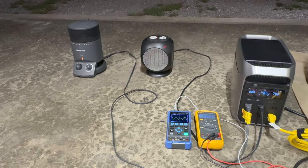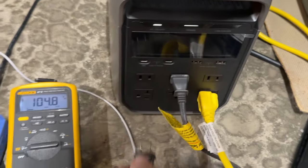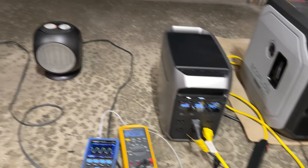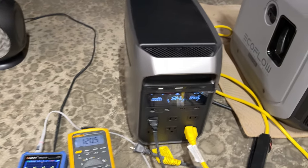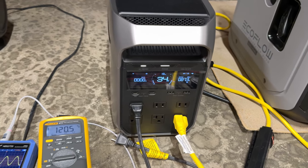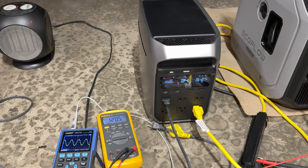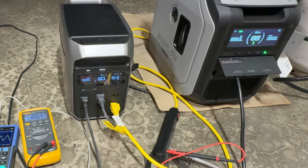We're actually running both heaters right now, well over 1,800 watts, but it's trying to keep it at 1,800. If we unplug one heater, it'll jump immediately up to 120 volts. The one heater is doing 1,400 watts. When we plug the second heater in, load increases, voltage drops, it keeps it to 1,800 watts. The second heater is pulling 900 watts. So 1,400 plus 900 is about 2,300 watts — but we're lowering that wattage by dropping the voltage. That's basically all X-Boost is: doing the numbers game by dropping the voltage to keep the wattage under the limit.